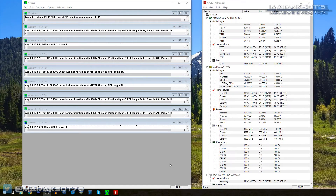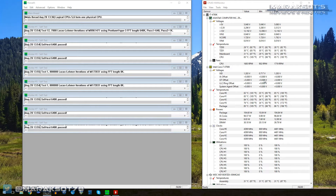It's been about 15 minutes that Prime95 has been running, and as you can see, the temperatures have stabilized in the mid-80s, which for CPU temperatures is pretty hot. But from what I understand of the 4790K, that's within its normal operating temperatures — I think it starts throttling somewhere between 90 and 100°C. I should mention that the ambient temperature in my room is somewhere around 80 degrees Fahrenheit, which is 26 to 27 degrees Celsius. As you can see, I'm running at 100% CPU utilization at 4.4 gigahertz. I set it back to stock speeds for this test to get a good baseline on all the numbers.